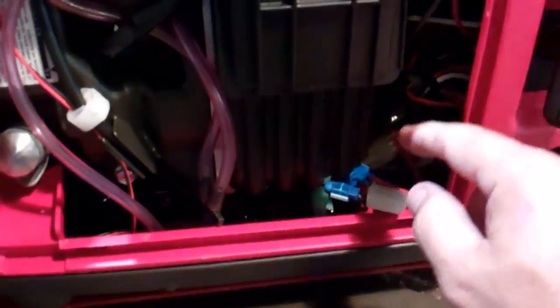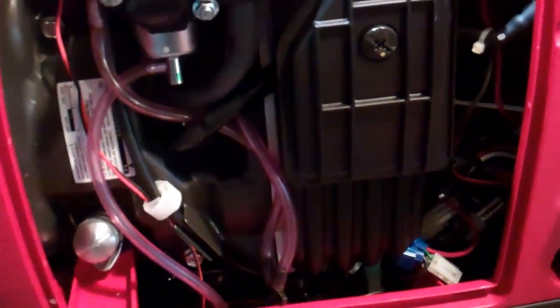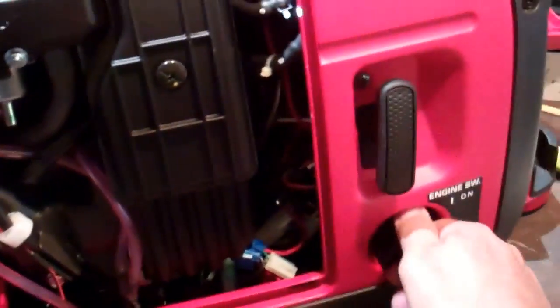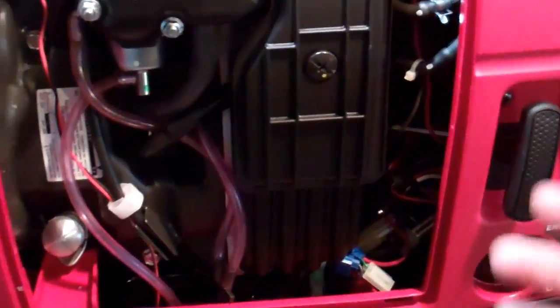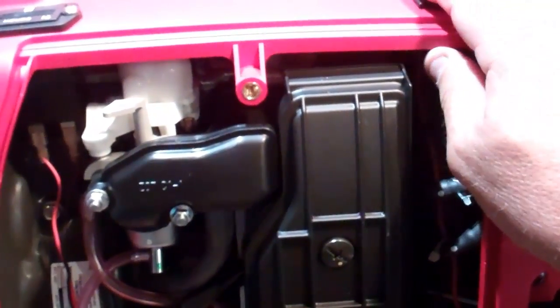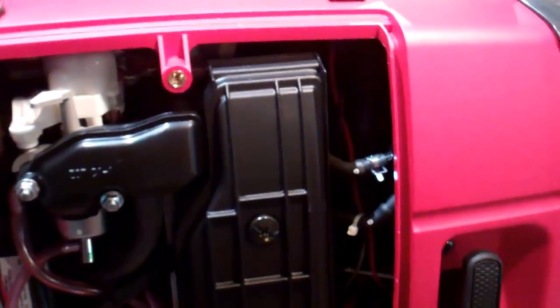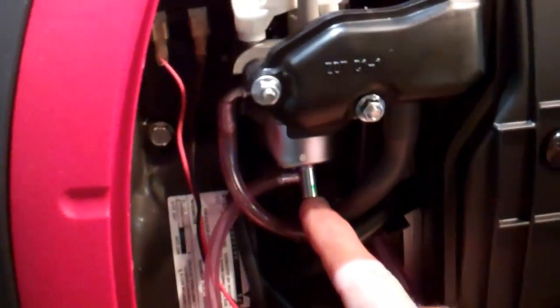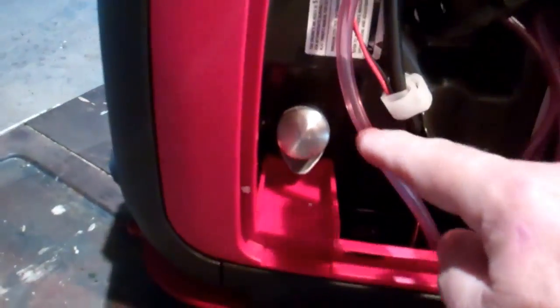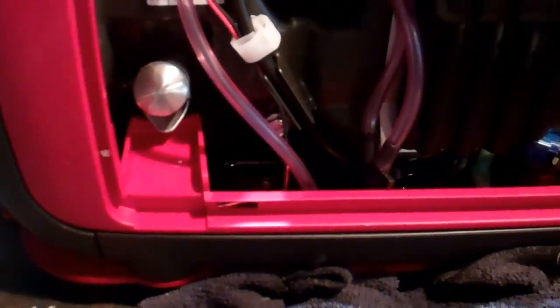When I'm ready to store it, I turn the valve off and let it run out of gas. But another option — and it's even simpler with no modification whatsoever — is to open the carburetor drain here. Just stick a screwdriver in the drain at the bottom, put a rag down there to catch the fuel, turn the screw to open it, and you'll see gas running out. You'll probably get about a tablespoon, maybe a little bit more. That drains the whole carburetor.